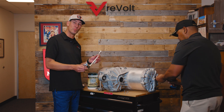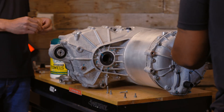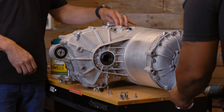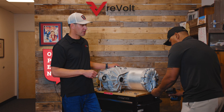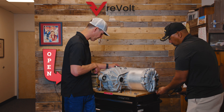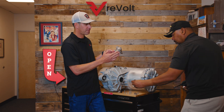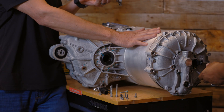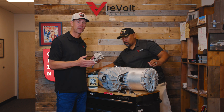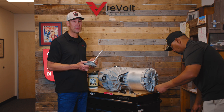This is the cooling rod being removed from the drive unit — go ahead and discard this. This is the inlet side of the motor, where all the fluid comes in from the car's cooling system. This is the original stock Tesla manifold. As the coolant passes into this channel, it splits two ways: one direction cools the stator's water jacket, and the other picks up heat from the rotor. This rotor cooling is no longer necessary. We've tested this on multiple vehicles — in fact, all the motors we sell now have this kit installed, because we don't want anyone returning motors due to leaky problems.